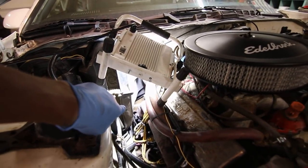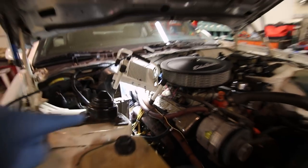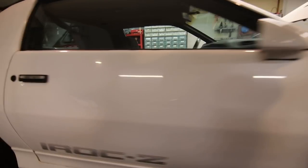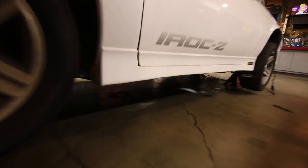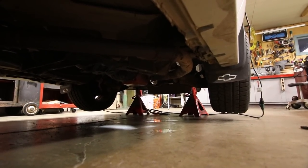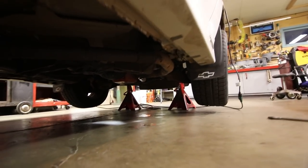is going to be way down in there. I can still hear it pretty clearly. That's got a pretty good exhaust leak, but otherwise, you can hear it better on the bottom. I think it's the collector gasket for sure.